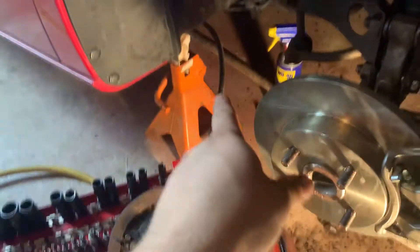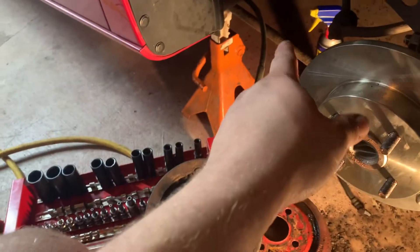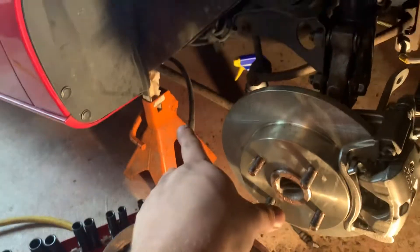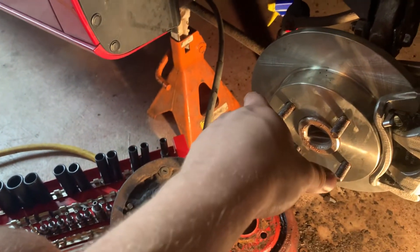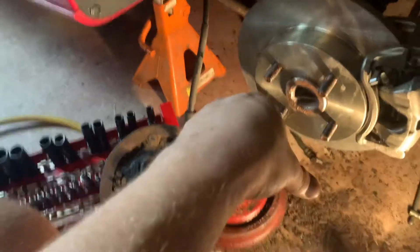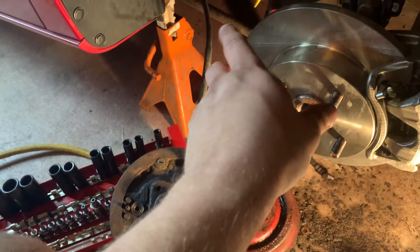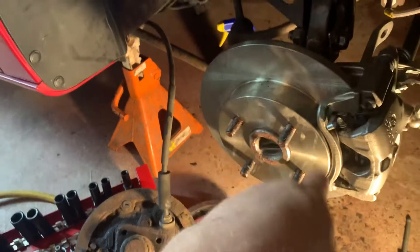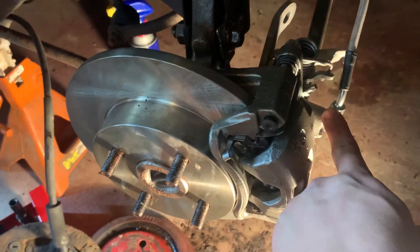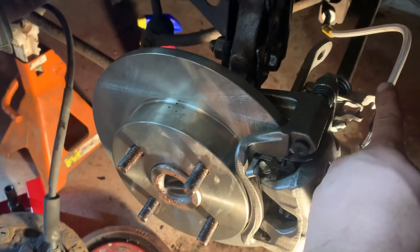Install the proper e-brake cable from a 1998 or any second gen Saturn with rear disc brakes. You can order that online — some auto parts stores may carry it but it'll be much more expensive there. If you can get it on Amazon, do it. I also really recommend getting stainless steel brake lines; for $100 they should drastically improve braking performance.